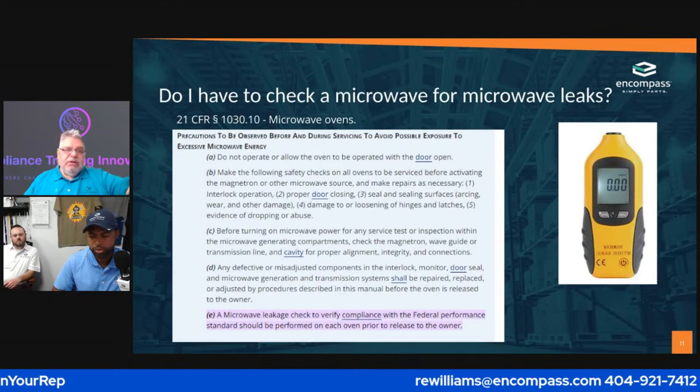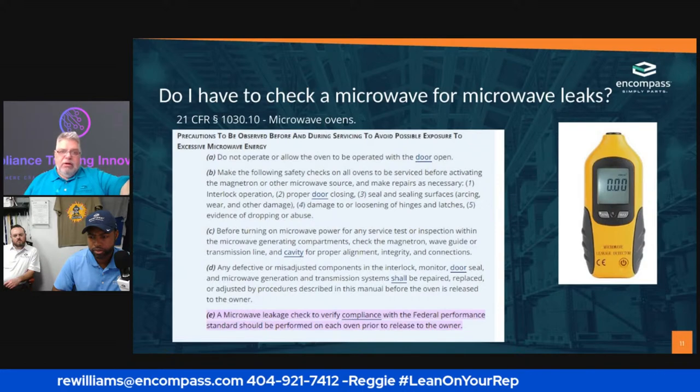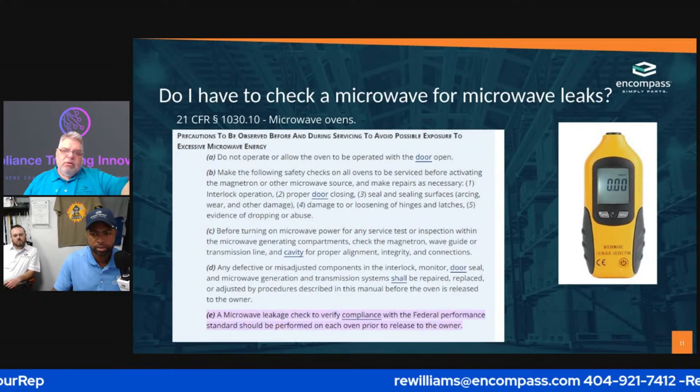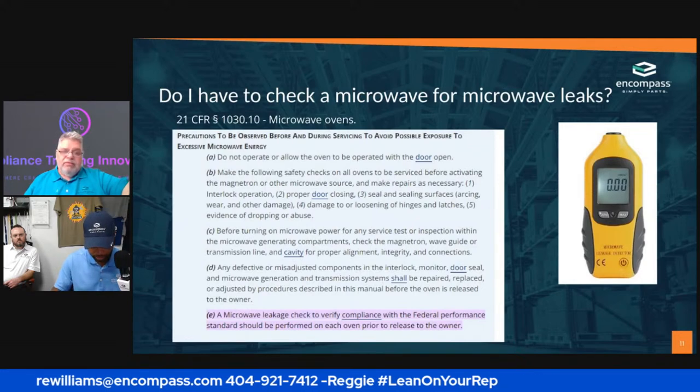I had a technician that jumped out a lid switch because the customer said she had 30 loads of clothes to do. The problem is, if she opens the door to the washing machine while it's in the spin cycle, you can have a real problem if the customer reaches in.